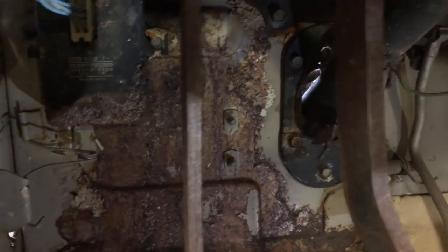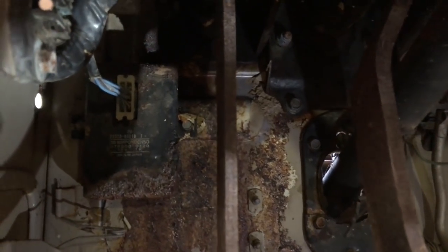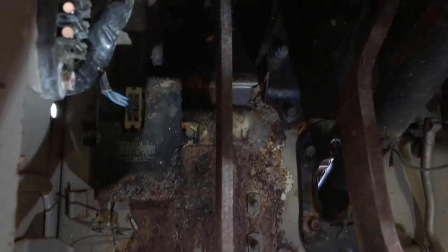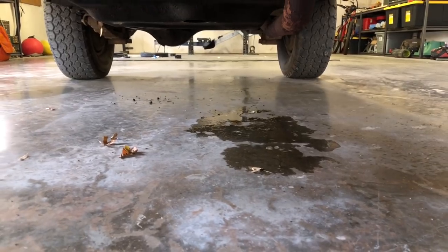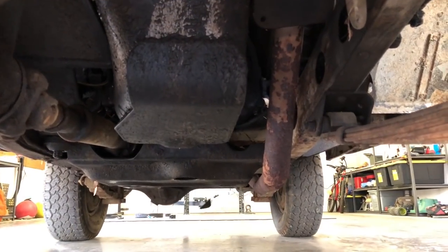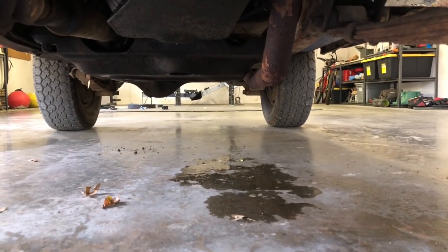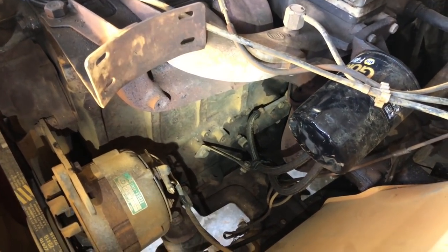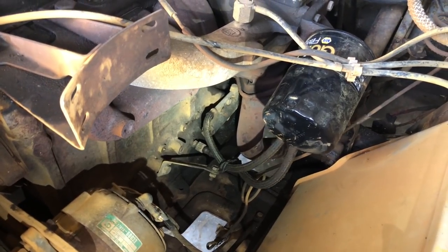The second issue I discovered was the hydraulic clutch fluid reservoir is leaking, and the clutch fluid — which turns out to be insanely corrosive — has dripped down onto the floor pan and into my wiring harness. As a result I have no lights and no functioning electronics whatsoever. Also, this one is leaking about an oil change a week onto my shop floor, so more than likely the rear main seal is having some issues. And there's a large crack in the exhaust manifold — from visual inspection the entire system appears completely rusted out. That's gonna need to be fixed as well.